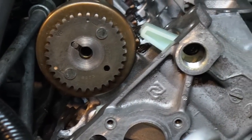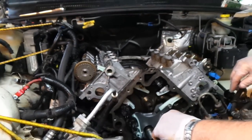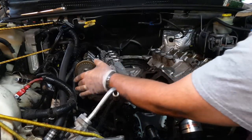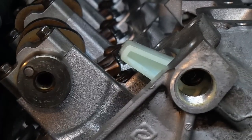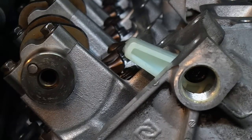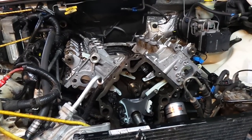Here's what may seem odd: we are actually going to put these gears on last on the vehicle. The reason is we're going to force the cams to marry the chains - we're going to move the cams over to the right spot. When it's in the right spot, you rotate the cam backwards and make the cam come marry it. That's how this is designed to work. You do not want to put the gear on the end of that and try to meet the chain - it won't work. You put the chain over the gear and then move the cam to meet the gear.